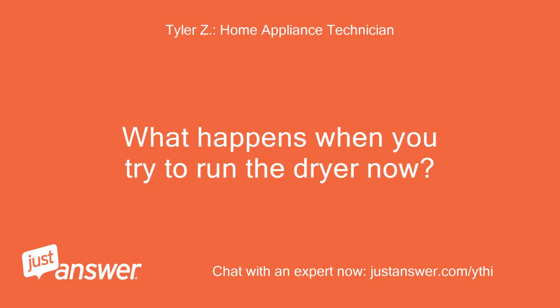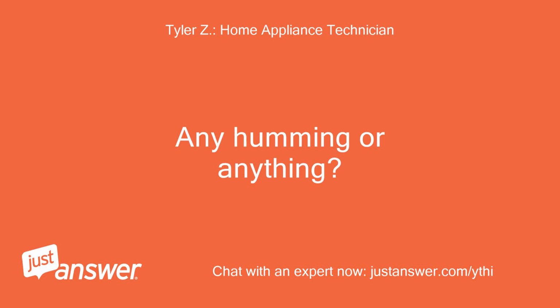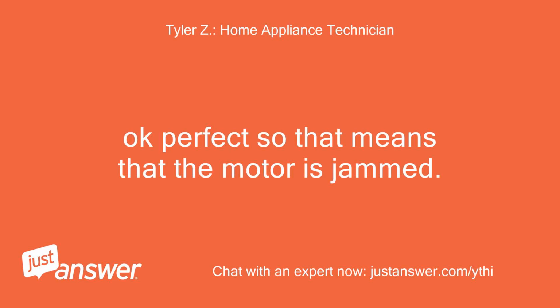What happens when you try to run the dryer now? Do you hear any noise at all? Any humming or anything? Brief humming and then nothing. Okay, perfect, so that means that the motor is jammed.